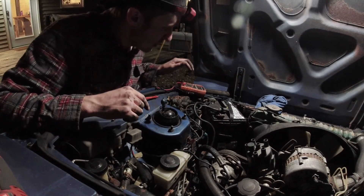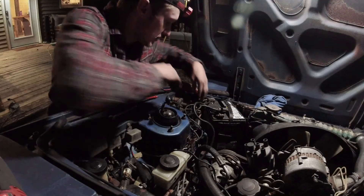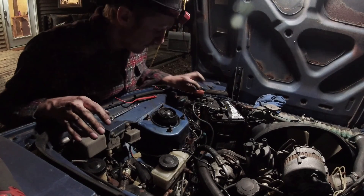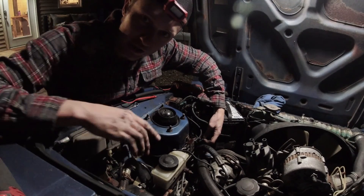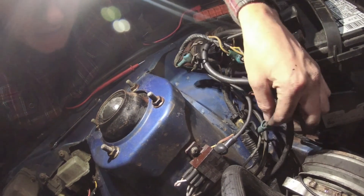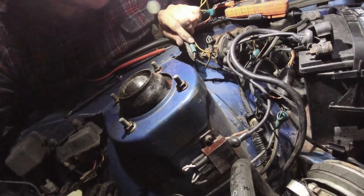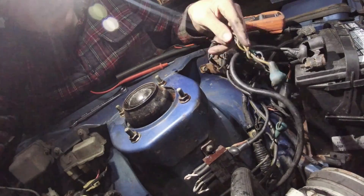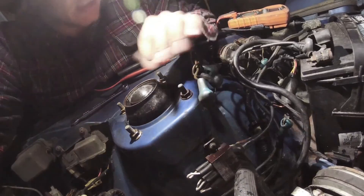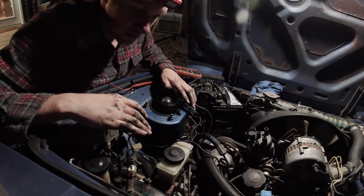When you're looking at the wiring on a 79, there's a whole bunch of these little eyelets over here that went to the coils, went to the resistors, etc. All of the ones that come up here towards the coils don't have any power — they get their power from two eyelets that are down lower that come out of the harness down here. They come out of the harness where this main fuse block charge harness comes from. All the rest of this stuff up here is pretty much unused when we convert to the new style ignition. These wires would have gotten their power and recirculated it through the resistors. So we're going to wire this up just like the 81 to 84s.